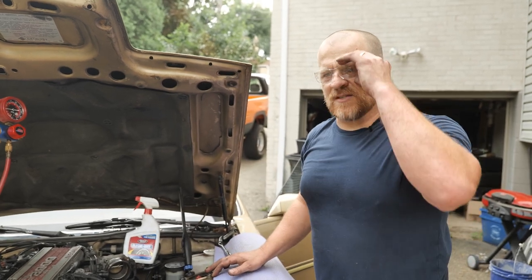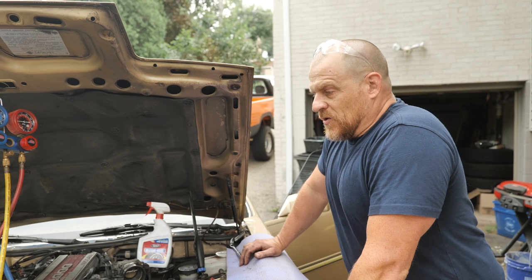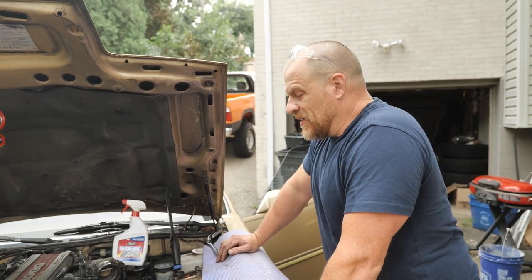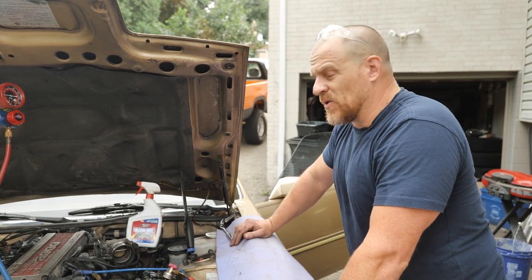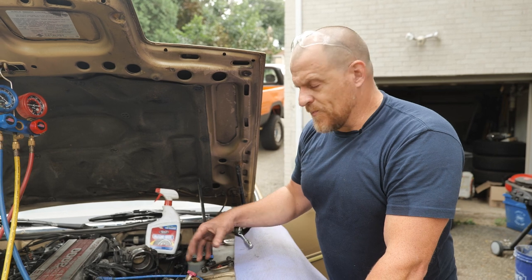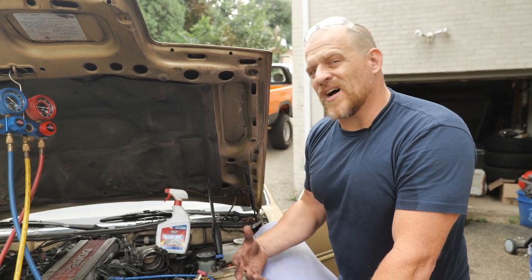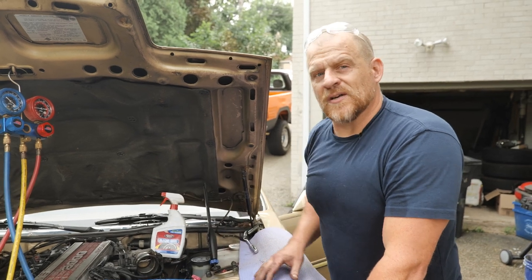Lots of questions on the last video about how much oil to add. And there's really no good way to answer that. You change and add oil based on the components. And you also add oil based on a leak. Some of you are thinking you had a big leak there and so you probably lost a lot of oil. And that's just not the case. When you lose refrigerant that quickly, you're not losing much oil.